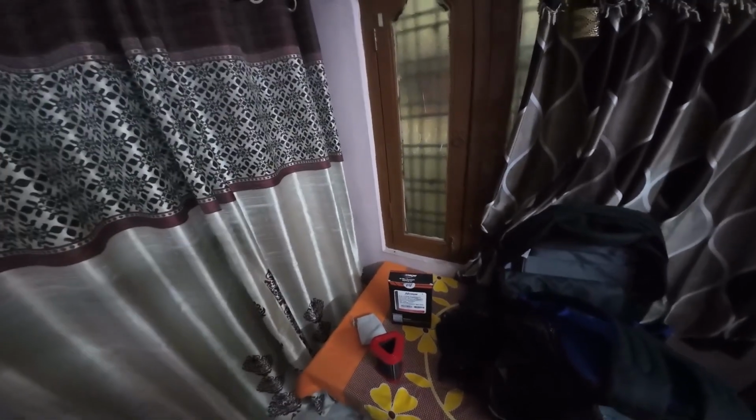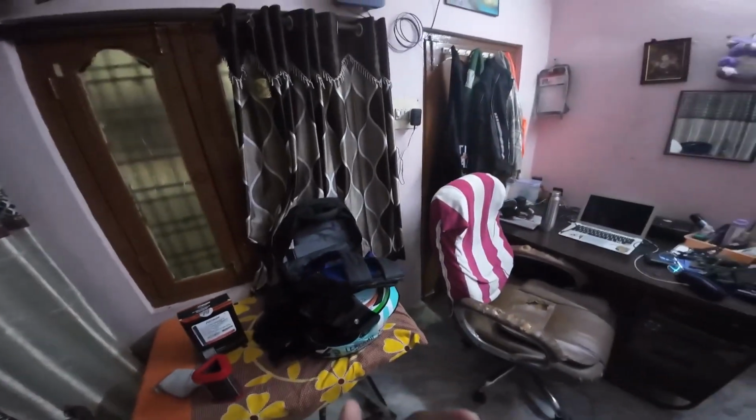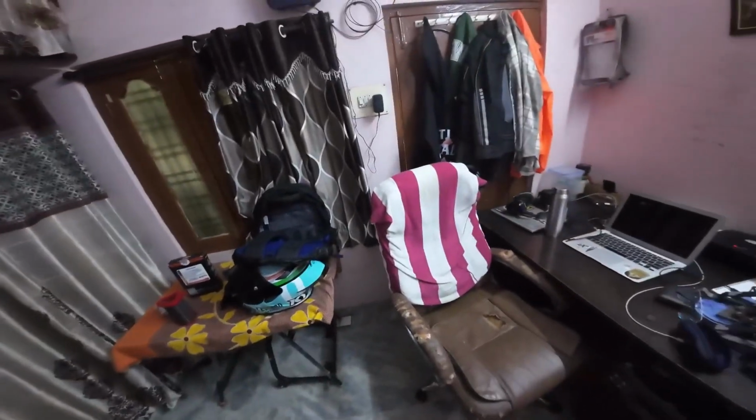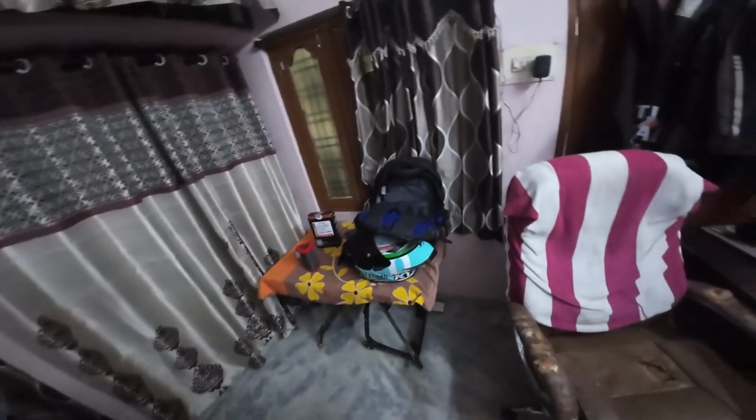It makes no sense that it's that dirty. So it depends on condition to condition, the city areas you live in. My area is mostly kind of dirty. The areas you travel to is also a variable. So yeah, just keep cleaning it after 5 to 7,000 kilometers. That would be a good number. But more than that, it's gonna clog up your filter more than it's gonna help. Let's just start the oiling process and we'll release on the filter and call it a day.